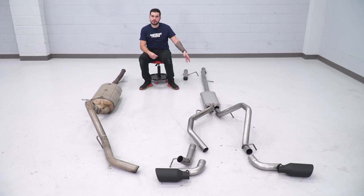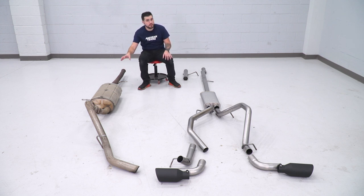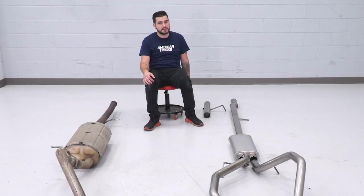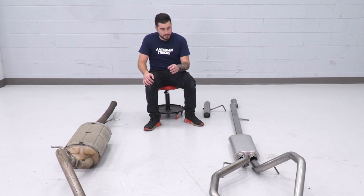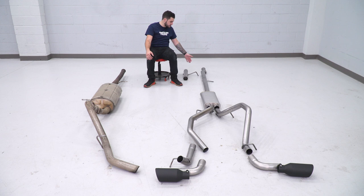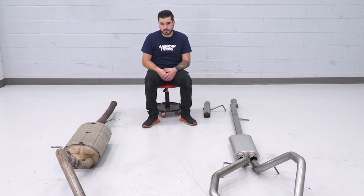So we got our factory exhaust off and it's on the ground here next to our dual exhaust. Starting at the front of our truck — your factory one has a little bit more kinks than your new option, just leading into the muffler itself, but overall extremely similar. Your new kit comes in two pieces, three depending on your cab length and bed size combination. You're gonna have an adapter pipe that'll connect right up to your factory cat pipe. If you do not have a factory cat and you're using something like long tube headers, this can work depending on the size of your long tube — it's a three-inch inlet, so keep that in mind to see if it'll match up to your new long tubes.